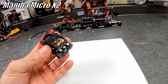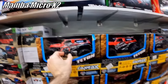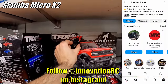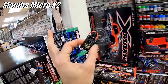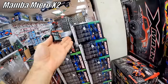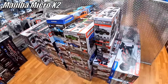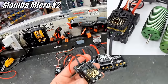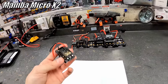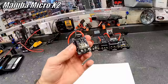You could run a little bit more depending on your setup and voltage rating. If you run more voltage you need a lighter vehicle to compensate the load factor. Walking around the hobby shop — you could put this in a Teton, LaTrax, TRX4M, Mini Revo, Losi Mini T. If you have a Rustler with no electronics, this ESC will push that brushless setup, which is amazing. It would also be a perfect ESC for a Granite Grom — they actually have a combo with the new 10-series motor. Run it on 4S and you can make it do standing backflips — an extremely overpowered setup. But if you don't push the voltage, you'll never make anything hot.